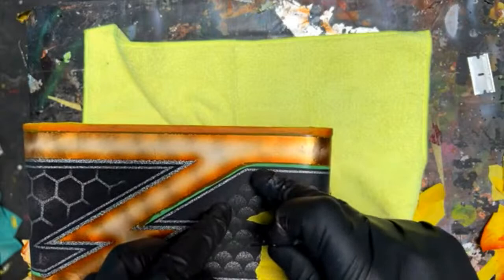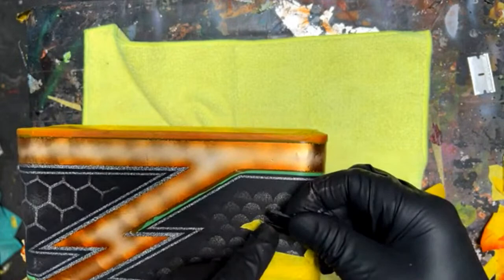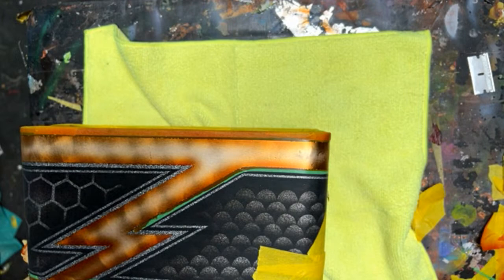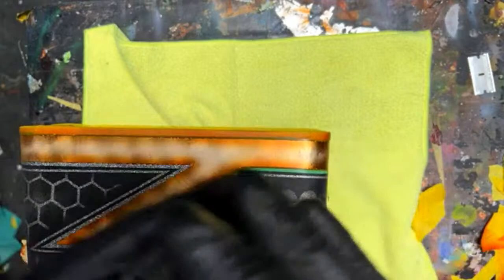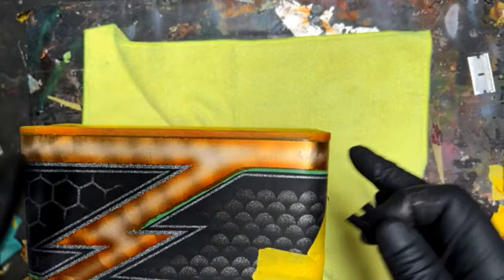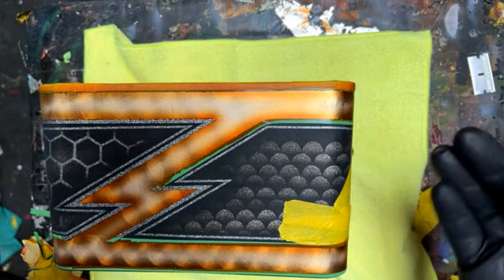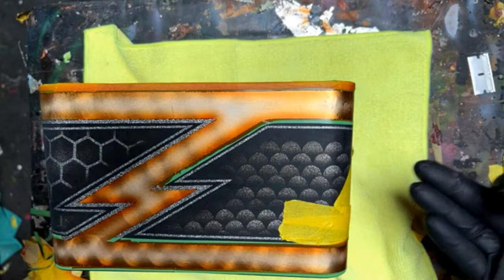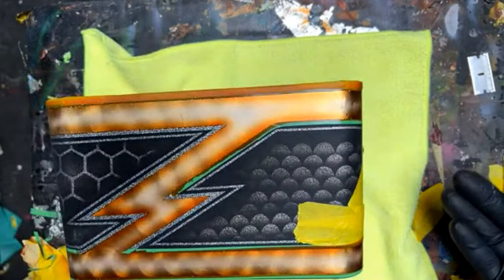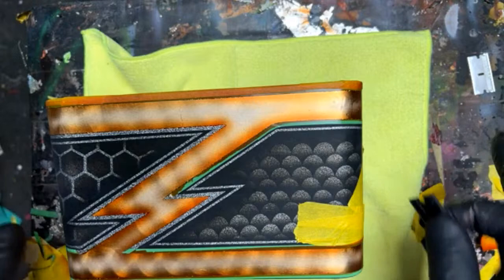Someone wants to know, where you're talking about clear, do you have to clear every layer? After you flake it, it needs to be clear coated, like you would be finishing it. You need to make sure you get enough clear coat applied and it's thick enough in mils to be able to cover the flake texture. The flake is chunky, and when it sprays on, obviously it's going to be a rough texture to start. Well, you can't really tape to that rough texture. So you need to clear coat it and give it a few coats of clear coat, let it dry. Then you're ready to sand it, and then you can apply your tape at that point. And then you would do your paint work, and then you would clear it again. You could do more paint work after that, clear it again. You just need to make sure you sand it in between coats. So hopefully that answers that question.